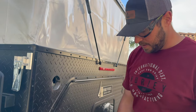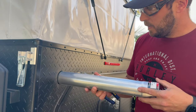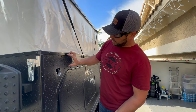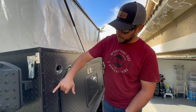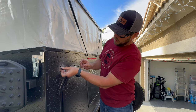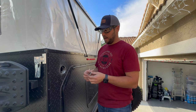Punched all the way through — got the hole roughly cut in. Now I'm going to clean up the edges and make it nice and smooth. This little maybe three-quarter-inch piece of material is all I had to take out of the framing. There's still solid framing up here, solid framing all the way down the edge, and a 45-degree piece connecting the 90-degree corner. So about half of this circle is a void anyway, and the other half is about one inch of material removed. I'm not worried about the structure — obviously Four-Wheel Campers doesn't support cutting into their frame, but personally I'm not too worried about it.